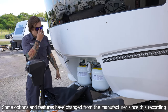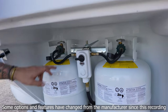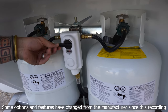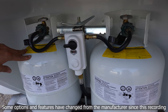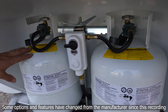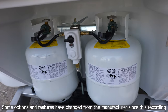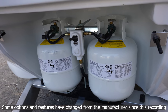Behind that we have two 20-pound propane cylinders, which will be full at time of delivery. They are separated by a T-bar and a regulator. Whichever way the arrow on the regulator is directionalized, that is our primary propane cylinder, and the other is our secondary. This is an automatic switchover regulator — if it uses the entirety of your primary tank and the service valve of the secondary tank is in the open position, it will automatically switch over and start drawing from the secondary tank.